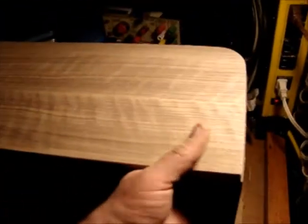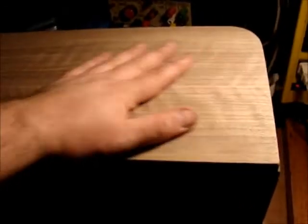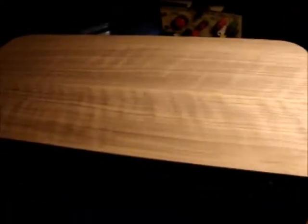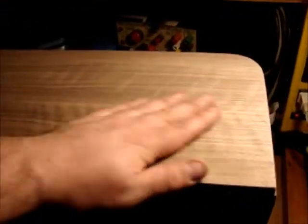I think it came out pretty good. There's one spot over here that needs some attention — it'll probably be quite visible but I'm going to try to patch a piece in there. It's on the back and that's the only real chip in the veneer other than what was on the top and the piece that's missing on the speaker grill. There's some tape residue along the seam but I'm not going to do anything with that until the glue has set up overnight and all the vapors have evaporated, so I'm sure it's stuck good. I don't want to use some thinner on the tape and have that soften up the glue — I want to make sure it's set up as good as it can be.